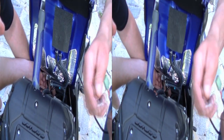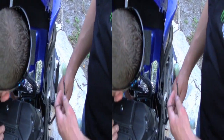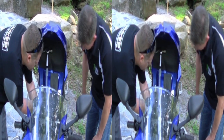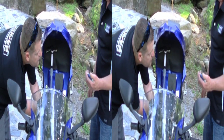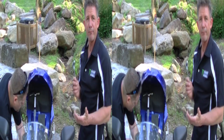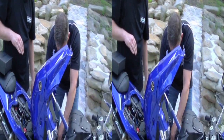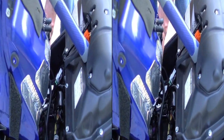So that's the key — this needs to be grounded to the engine and not to the battery. It's a little tricky if you don't take the tank off, but it can be done. It's probably easier to take the tank off, but we saved a bit of time by leaving it on and didn't spill any gas. Just take this lead, wrap it up and keep it up against the side of the frame. Plenty of clearance there.